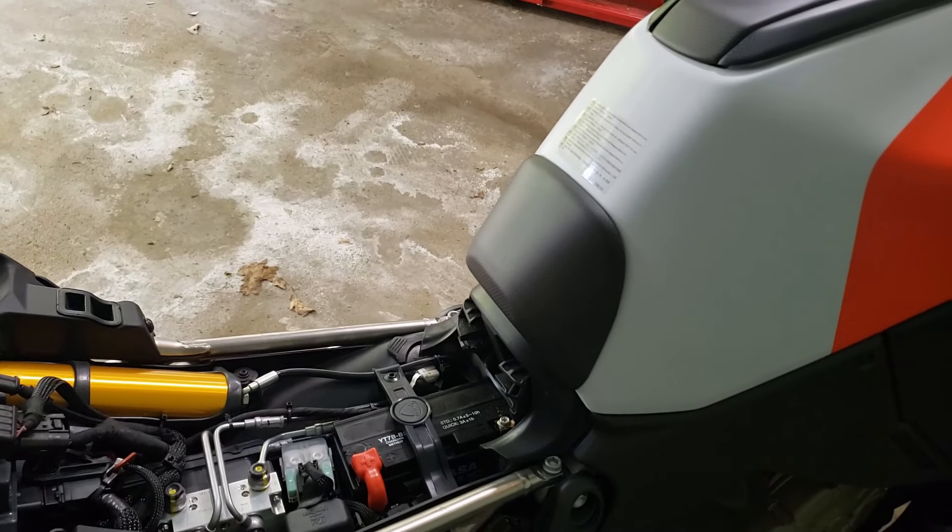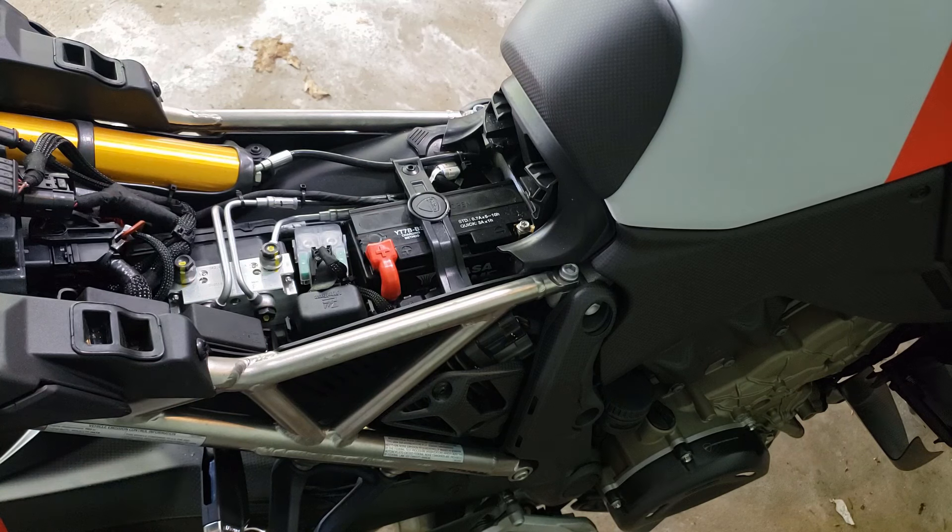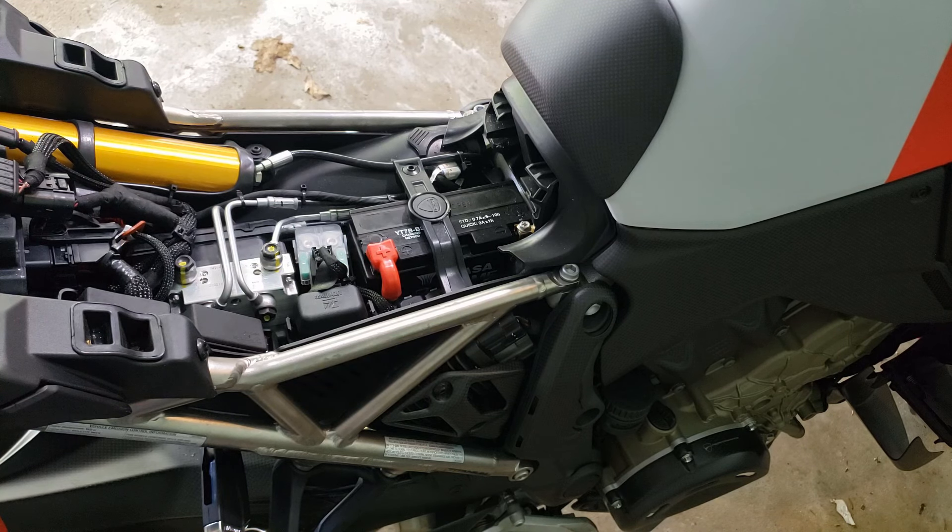So there's your battery. Note that on this model, this comes with a lead acid battery, but you're always going to want to check anyway, because some Ducati motorcycles — such as my 2022 Street Fighter V4S — some of the models had lead acid and some had lithium. So you definitely want to confirm that before you connect any battery tenders to it. I do always recommend connecting a battery tender because these batteries will die over time, and if they get too low in voltage it might damage the battery, but more importantly it might spoil your ride that you had planned for the weekend.